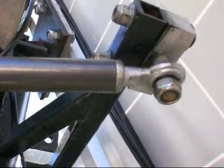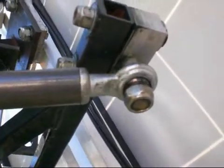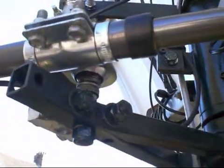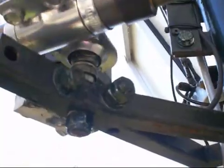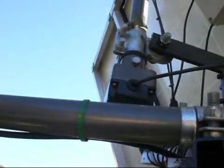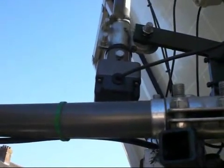Something else to remember when putting these connections on — make sure you grease the ends so they are loose. You don't want this to be tight. When I put mine on, as you can see, I can actually lift it right the way up and it's loose on the wheel bearing, so make sure you've got some good copper slip or something in there which will allow it to twist. Also make sure it doesn't hit the actual metal bit. I've done the same with the top one — as you can see up here, it actually twists quite freely. Anyway, that's just the final bits about it. Hope you were successful — any problems, give me a call.